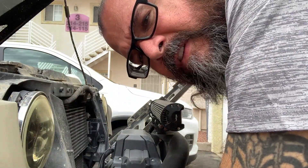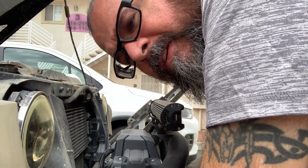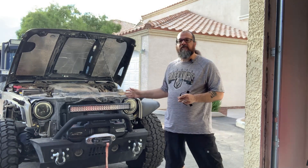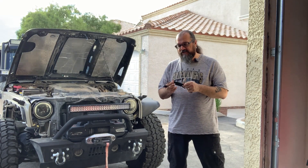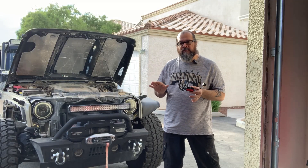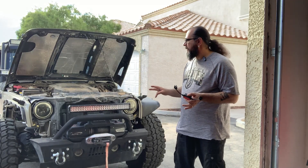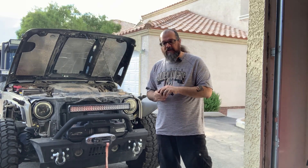We're going to further investigate. I'm not going to waste a lot of video time running the wires — I'm going to get some kind of probe or scanner to find out what's going on with this and get to the end result as fast as we can. We actually got it figured out. Most of us like our aftermarket headlights — the halogen type with the halos — and we all know they need to be regulated, because they don't necessarily work right when you plug them in. So there's such a thing as this anti-flicker LED diode, which helps regulate the lights so you can get your headlights and high beams working right. I went ahead and removed the headlight and took a look at this diode — it all tested fine. All the resistance on it was good.